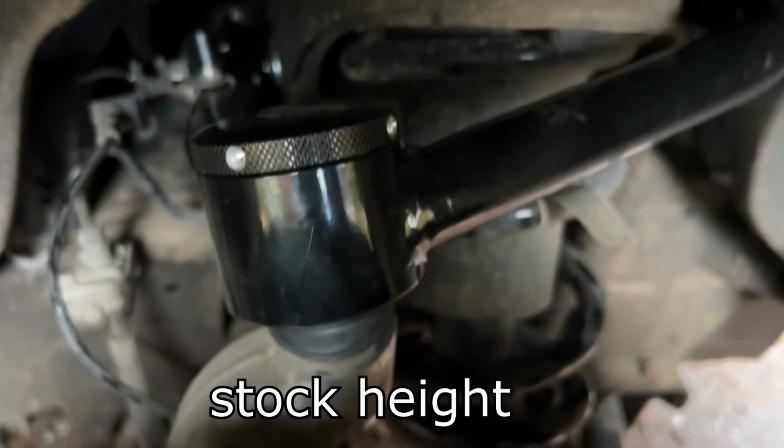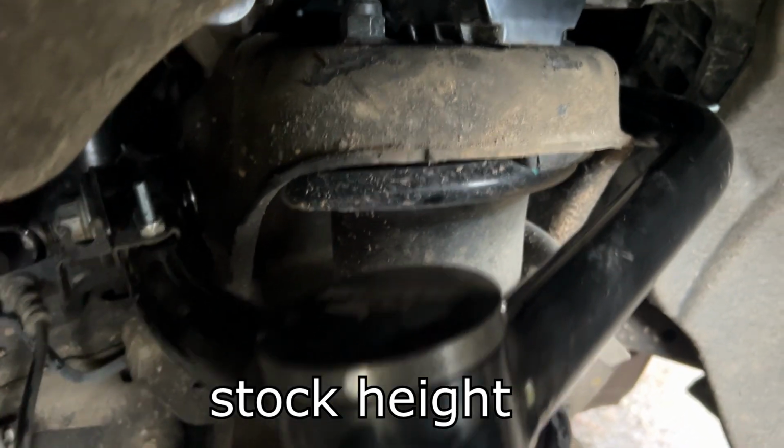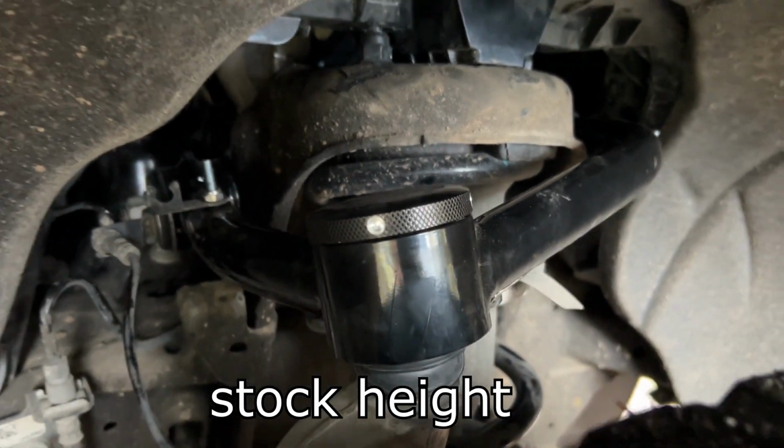Just make sure you install them on a lifted vehicle. Do not install them on stock ride height because they will not sit at the right angles. They need to be at least 2 to 4 inches. In this video, they're installed at ride height, but 2 days later, I installed a 2-inch lift up front, level kit. So now it's back to being at better height. Install only on lifted vehicles, but I think they're great, guys.